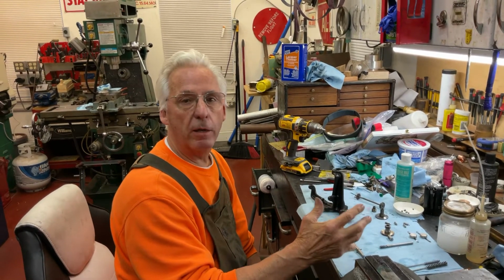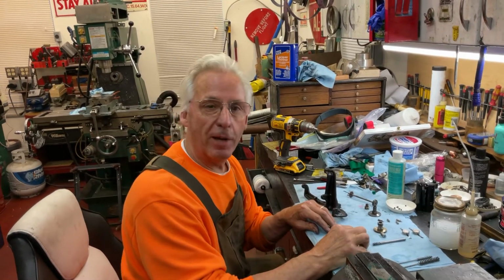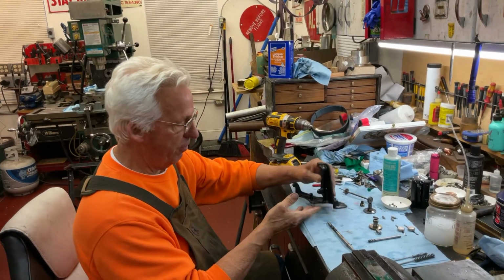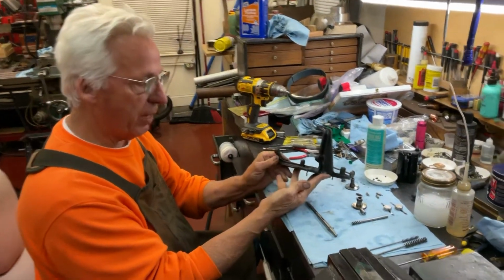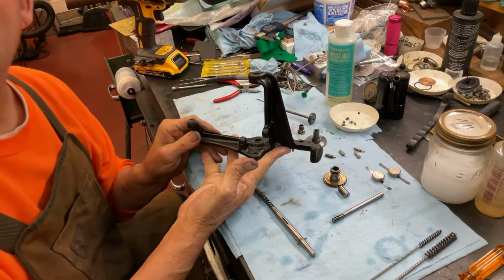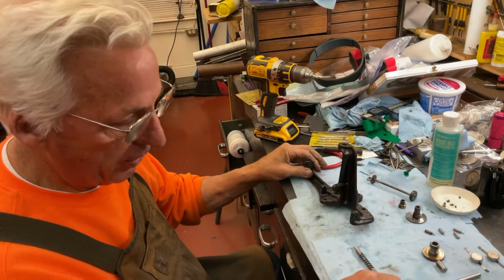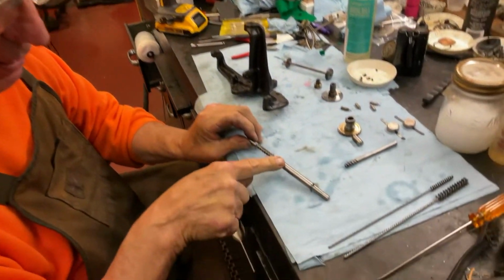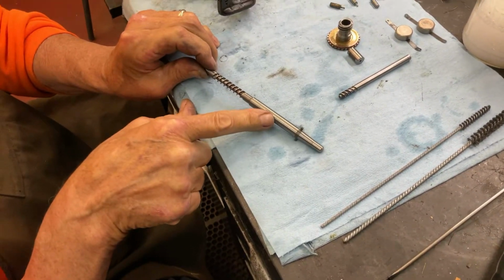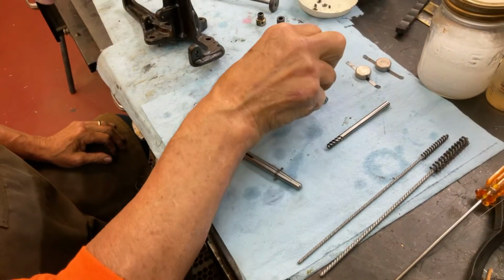I'm back on the Edison Opera here, and I've been working hours. What I'm going to talk about is the casting, the spindle shaft governor casting pre-assembly, and there are some tricks to this. What I've done is I've polished everything out like this. We see a little bit of rub marks here on the spindle shaft. I've polished this out. I've taken the governor apart.